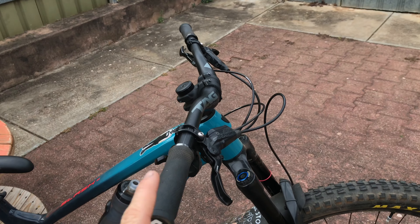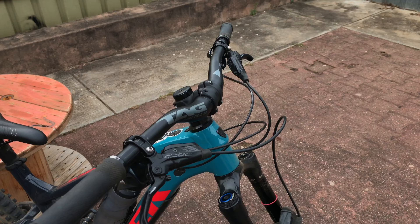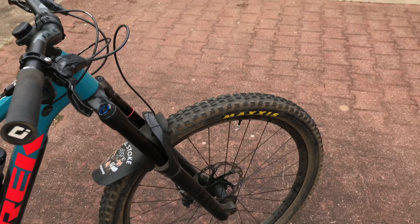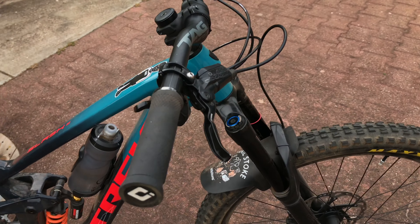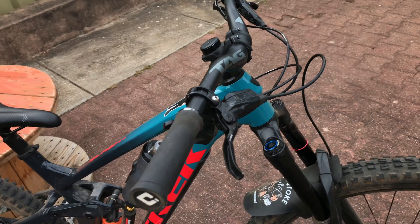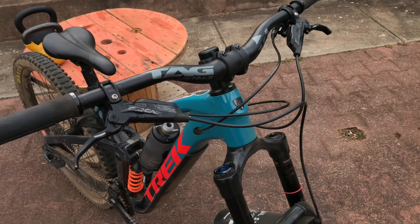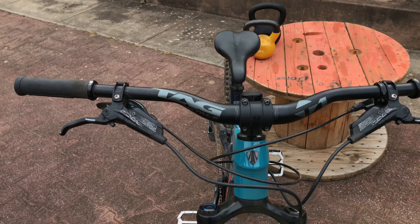What I found when I put these on is the Bontrager bar is really soft — quite flexible and compliant — whereas this is way more direct. More direct steering is quicker, which also means a little bit more feedback through the bars. But to me that's not a detriment; the benefit of a more direct front end outweighs the slightly less compliance from the firmer bar.